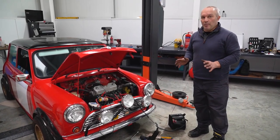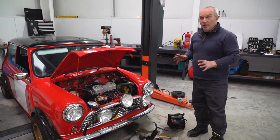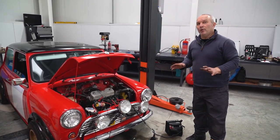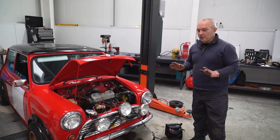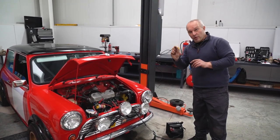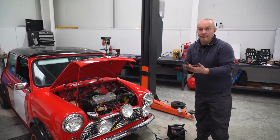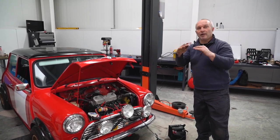It's now time to move our focus over to the carburetor to make sure everything's running synchronized. A quite common fault you find on Minis, MGs, any car built with the old SU carburetor is that the dashpot piston quite often runs dry. It's needed to give hydraulic resistance to the raising of the piston and what needle profile it presents to the jet, but also it adds stability — especially on deceleration — so when you lift off the gas, the SU piston returns to the correct position at the correct rate of fall.